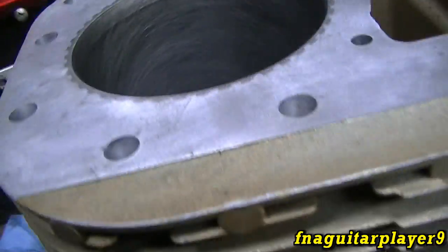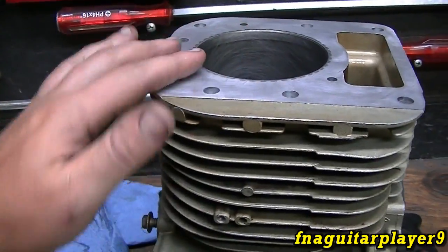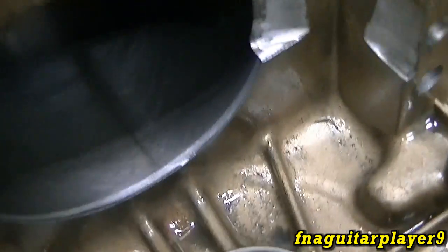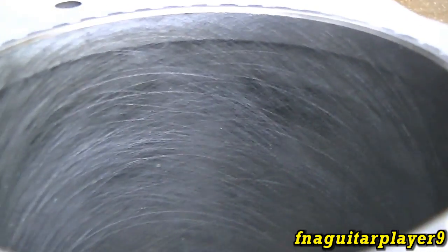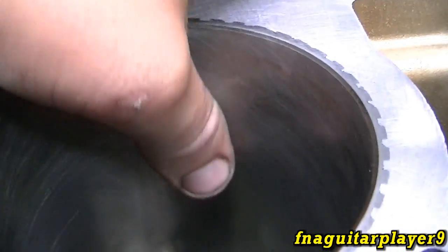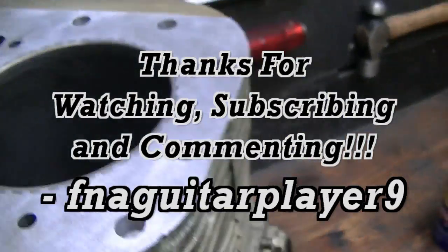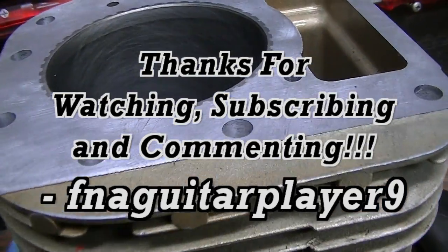This block is in really good shape. I just got through surfacing it — there's another video on that if you're interested. You can actually see the hone marks better on the bottom part; some of those marks are probably the original factory hones because the rings don't contact that bottom part, just the piston does. It looks like it's really scratched up but you can't even feel it with your finger. Like I said, don't try to bore it out with a hone because you're not going to be able to do it. If you have any questions about honing small engine cylinders, leave a comment below and I'll get back to you as soon as I can. Thanks for watching.